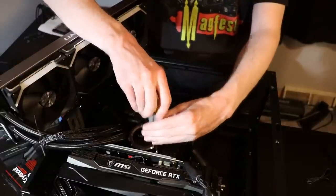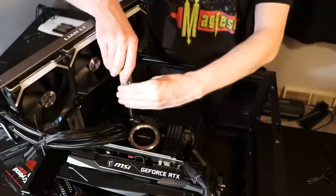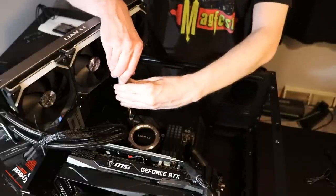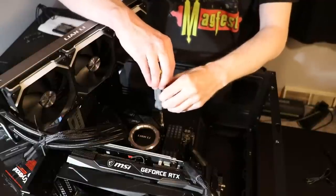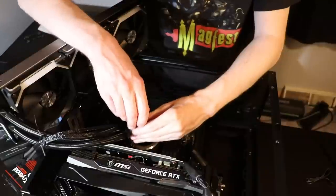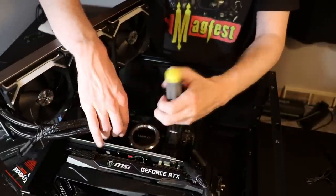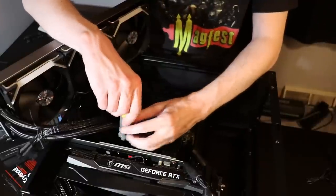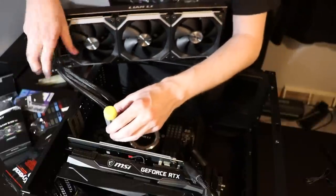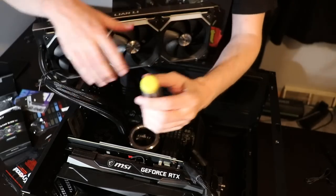All right, get those nice and tight. Tend to want to screw them on in a cross formation, like, you know, go X, so like diagonal. That way you're semi-evenly distributing pressure. It's important for pretty much everything involving these computers. A little bit, that way I can finish putting that on. And there, secured.